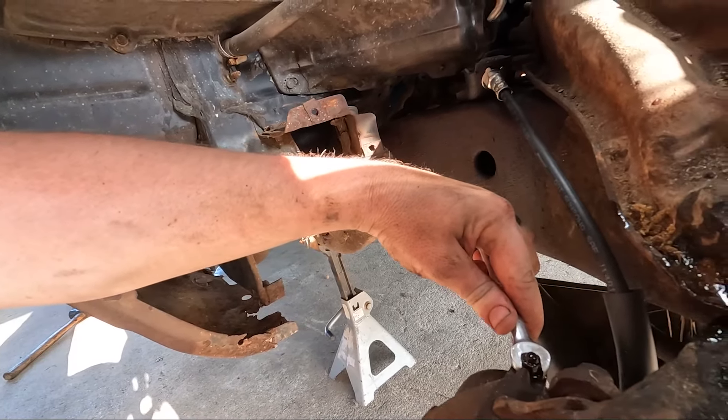I suspended the search for the rear brakes - they never showed up on the vacuum bleeder, never once got a drop. I think I found the issue after I'd put the car on the ground - I kept seeing a leak, and this line right here was leaking. If I'd have seen it while I was doing the bleeding I could've fixed it, but we're out of time. We got front brakes - that's all that matters right now.